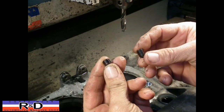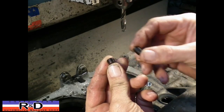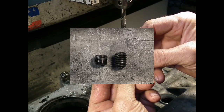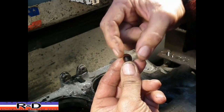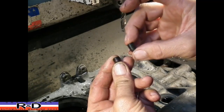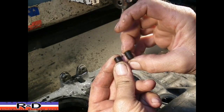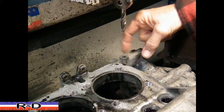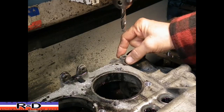I've got a pipe plug here and a regular Allen screw, and I'm going to put an inset in here so you can see the difference. You can see that the one on the left has a taper to it going down from the top to the bottom — it gets smaller. On the regular Allen screw it's straight threads all the way through. So you can't be screwing this thing all the way down because if you do, that ruins it for the next time you rebuild the engine.